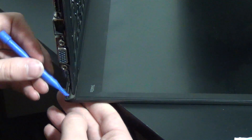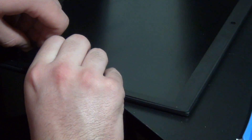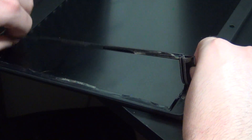The first thing we have to do is get the outer bezel off. Since it's held down by adhesive strips, you'll want to get a plastic spudger or maybe just your fingernail and see if you can find a large enough gap around the bezel to start prying it up. I usually have the best luck at one of the bottom corners. Once you have a good grip on the bezel, you can start to peel it up. With a little bit of effort it should start to come off, and after a while you should be able to easily get the rest of the bezel removed. The safest method is to apply even pressure on both sides as they start to come up, since the two sides separate from the corner. It's okay for the bezel to be bent, but be careful not to completely fold the bezel onto itself, as it will leave a mark that is very hard to get rid of.